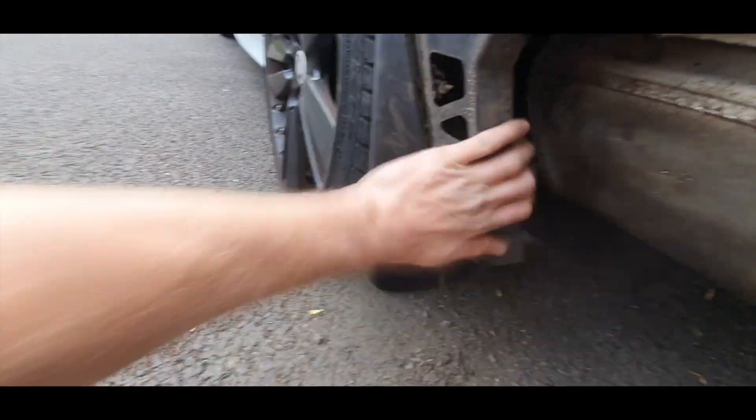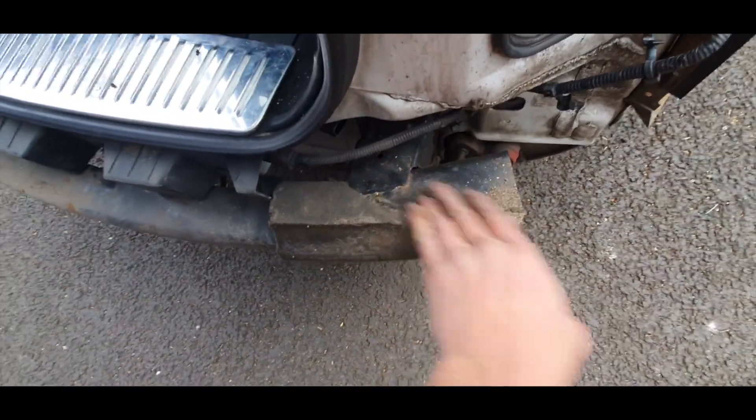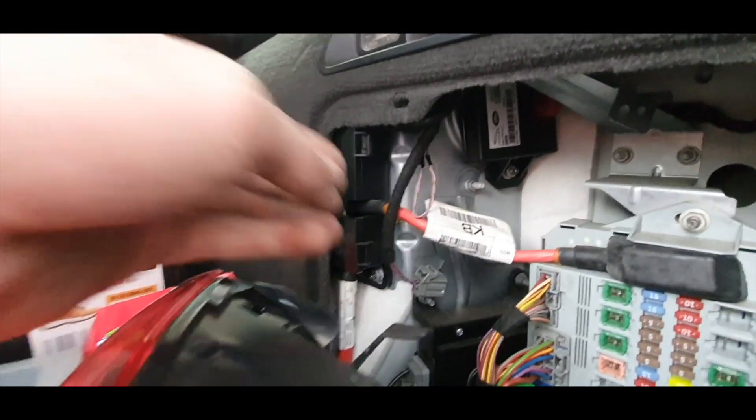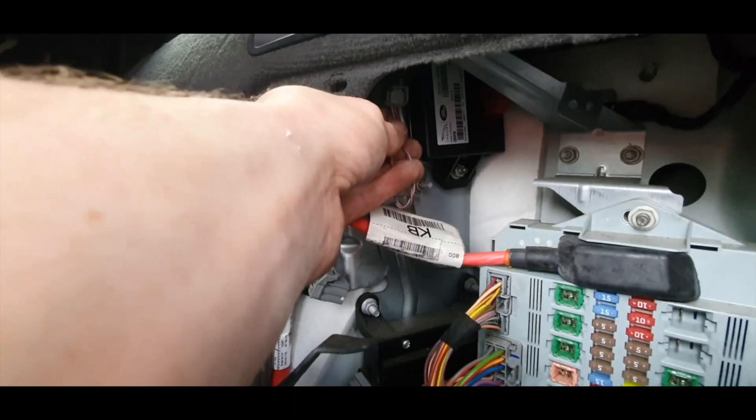Right, put the bumper back on. Also worth mentioning — in here you need to take this cable and plug it in to where this loop is plugged into. Unplugged the loop, plug in the cable. The Jag is a 2015, so it's literally the last of the line black edition. I believe all the facelifts, if they've got the rear parking sensors, will have the wiring for the rear radar sensors — but don't hold me to that.